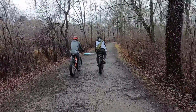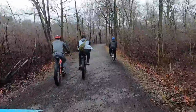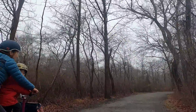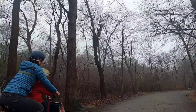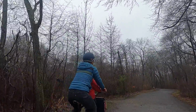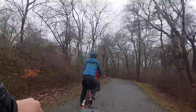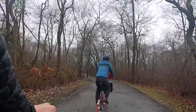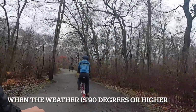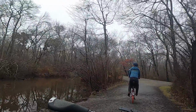In the winter, we've noticed that there's far less rolling resistance. I would say compared to a normal tire, they're within 5%. And in the summer, when the roads are hot, you're riding on the asphalt, you do notice quite a bit of rolling resistance. I would say on average in the summer, you're looking at about 20% rolling resistance. So I would imagine if you lived in a hot area all the time, these tires would make you tired.